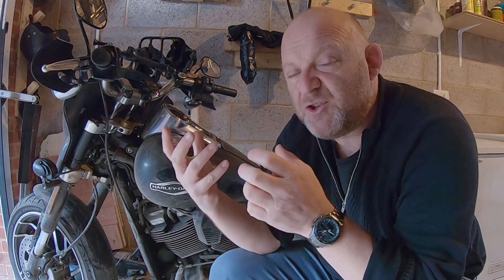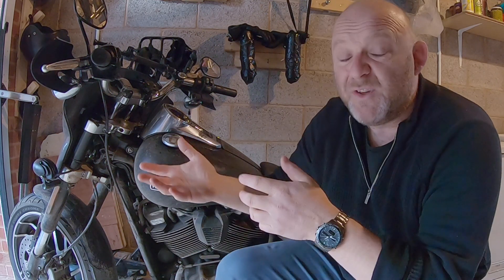Obviously you'll have to pay - it'll be about a hundred pounds, dollars, or whatever currency - but they can do it for you. A brake flush every two years, but it's a moisture content above two percent that's what you're really looking at. You could have it in there two, three, or four years and it should be absolutely fine mostly, but check it on a regular basis, certainly after two years.